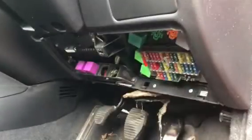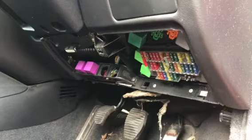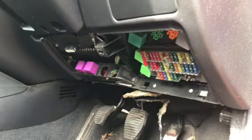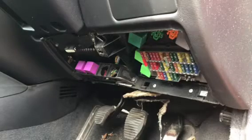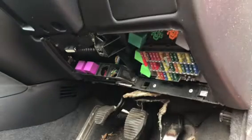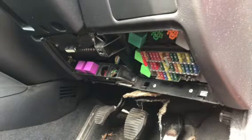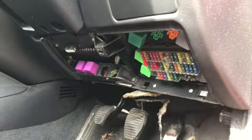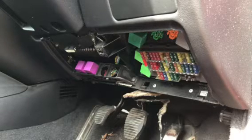But you know, I hope this helps. I don't know how far you're expecting me to go with it, but I'm glad we got as far as the relay. It's good to have a wiring diagram with you, so you know what you're looking for. We had ignition on, fuse box, relay, resistor, and then you're going into the actual blower and everything as well. So we had a diagram, told us where to go, and that's a job done.